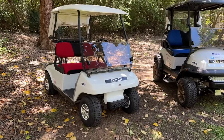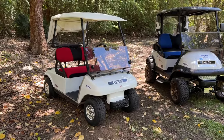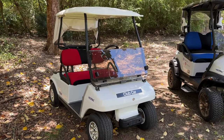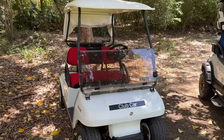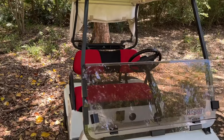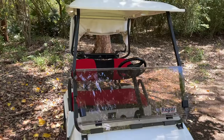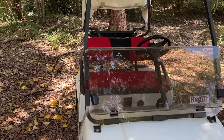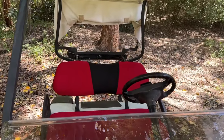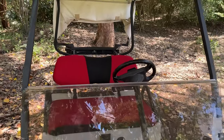If you're looking at electric, the earlier ones are 36 volt and the later ones are 48 volt. A very easy way to spot a real early one versus a real late one: the windscreen frames on the later ones like this are tapered in and the seat back is connected, whereas on the earlier ones the windscreen frame is straight and it's a two-piece seat back — a left and a right cushion.